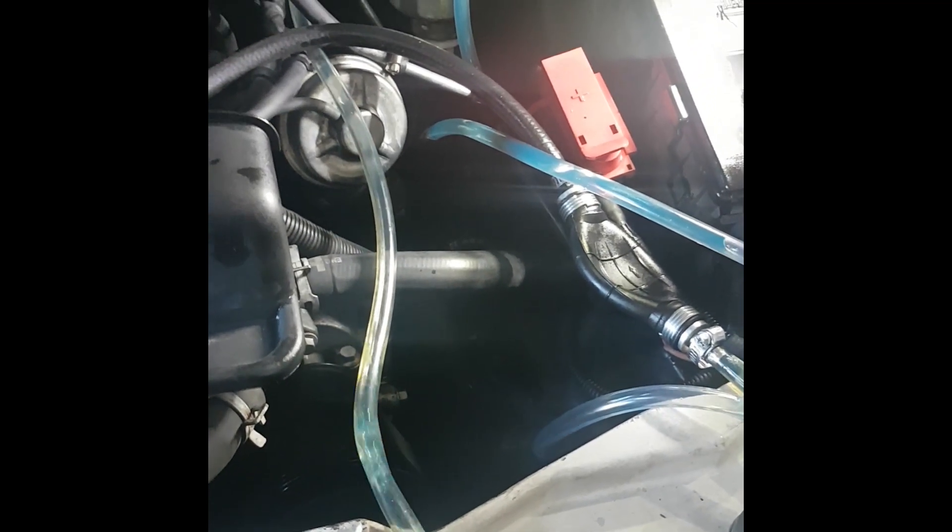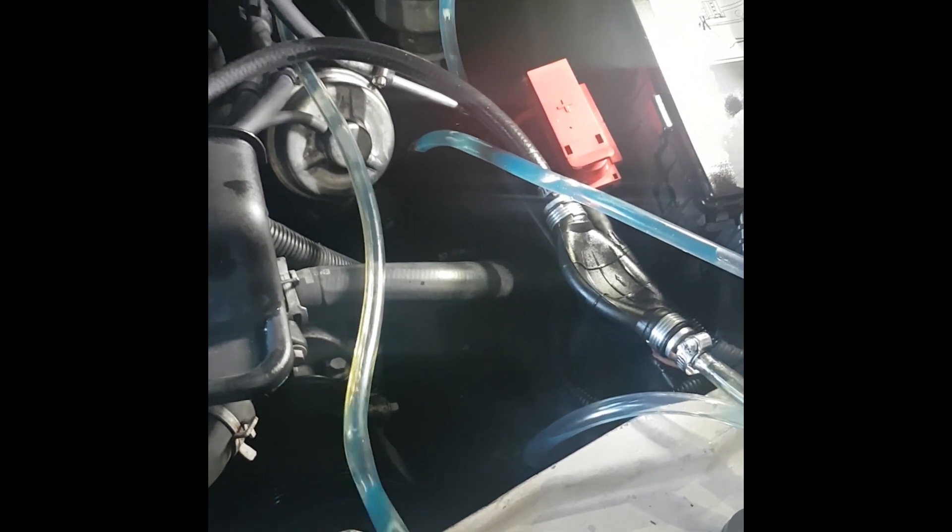So the first thing I did was put some clear hose on the supply. I want to check if it's got good low side fuel, and I'll get you a shot of what it looks like. So not ideal here — we've got a lot of air in the system, which definitely could be causing these high pressure fuel codes.